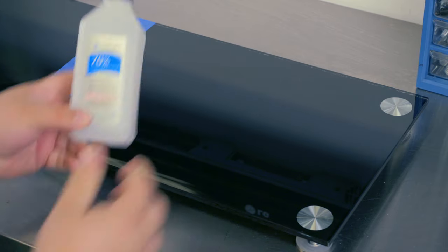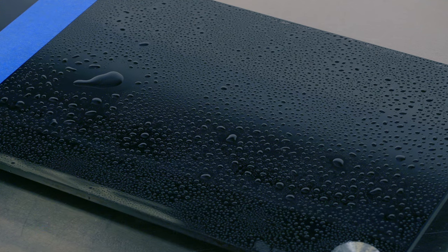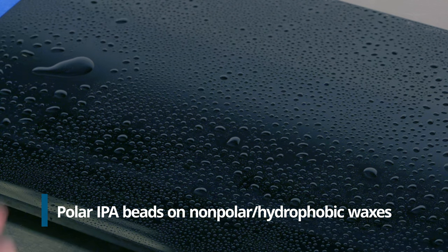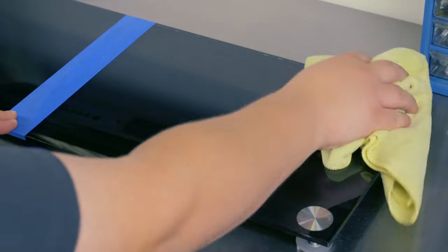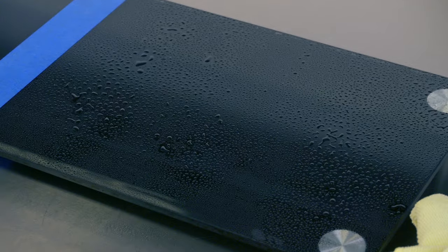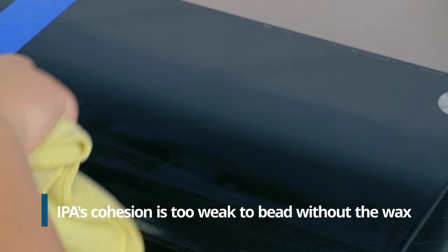Let's see how this product responds to isopropyl alcohol. I've got this 70% ISO and we're going to spray some on — I don't score this test. You guys can see it's not immediately failing; it is actually clumping together. Isopropyl alcohol will not clump like water because it just doesn't have as much surface tension. Once it dissolves the wax it usually stops clumping altogether, while water will always still kind of clump. We're going to wipe around and see if it will act as a non-polar solvent — it might take a couple of applications, or it might never come off. We also saw much the same thing with the Turtle Wax Seal and Shine — it was very resistive to isopropyl alcohol.